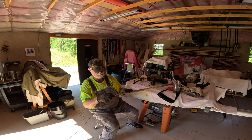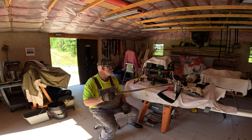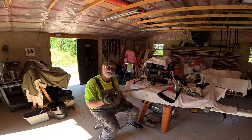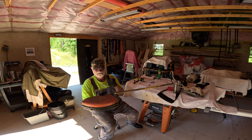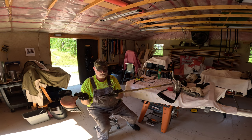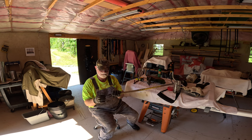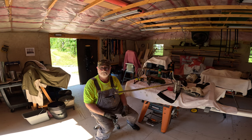Now this is the drive cable, and it's really pretty easy. That goes up in there, meshes with the drive up at the motor, and then there's a square that's supposed to be on this end that fits down into the hole here. But when I took this piece off, I took my magnet, fished down in there, and that's where the square was that's supposed to be on the end of this. So basically, this cable is squared off on the end to fit into the two drives. And that square broke off of this end.